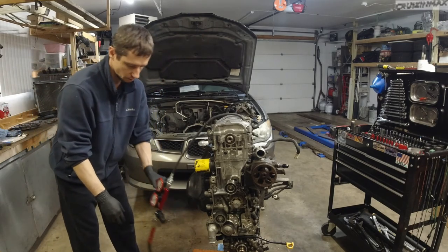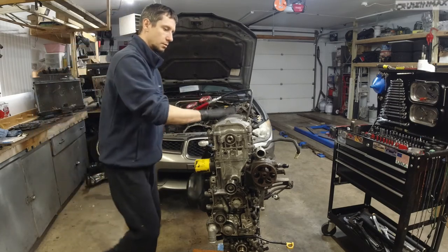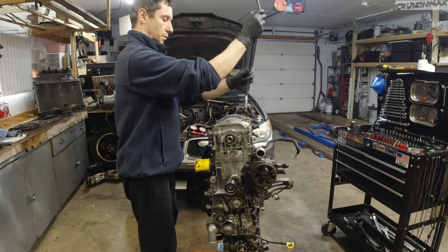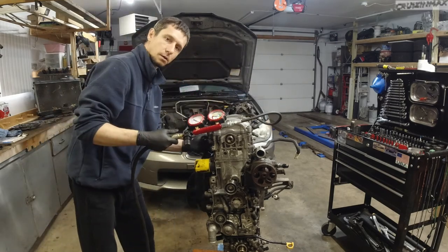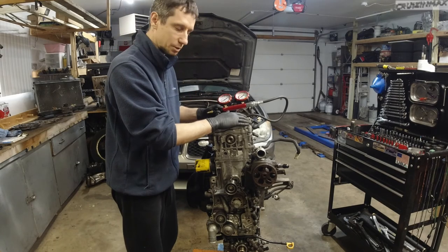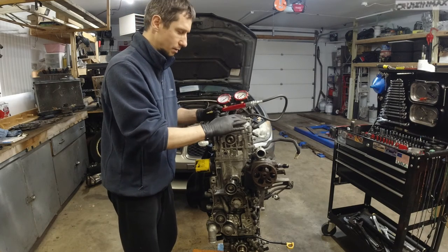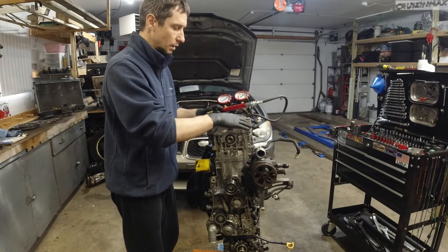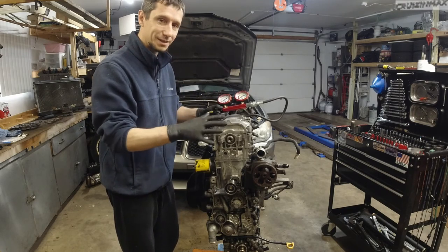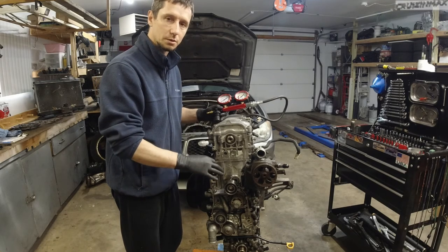Okay. Moving on to number three. Remember, 1, 2, 3, 4. Exactly the same. A little bit here, mostly the exhaust valve. The compression test was very good actually. It was 170-something on cylinder number one, and everything else was like 170-ish, almost there, 168. So very close to each other. No worries there. I'm not even worried about the pistons or the rings.